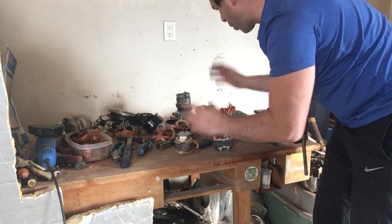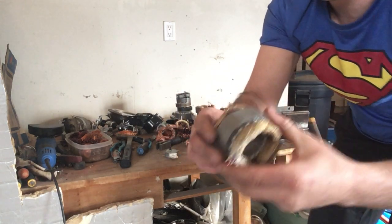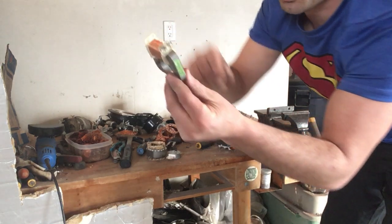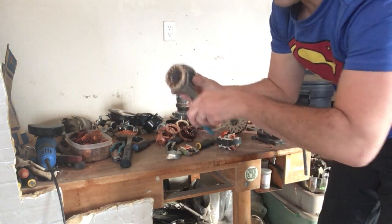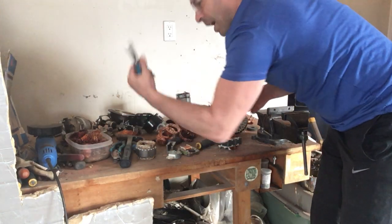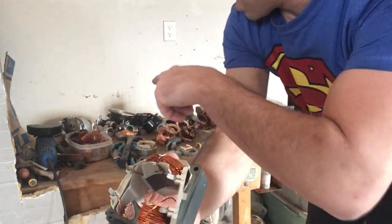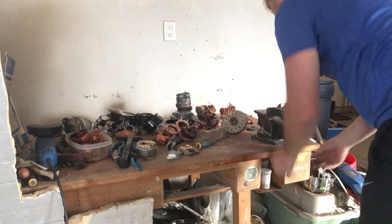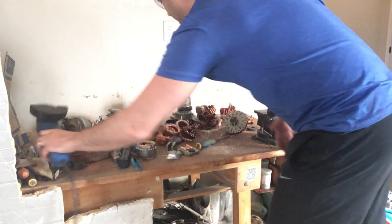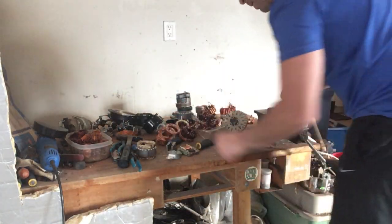The styles of motors you're going to find — some of them will have two windings of copper, some will have a large ring of copper around them, and they're very easy to take apart. This is one of your motors from a microwave. For me, the nicest thing is you can use a pair of tin snips to cut around this, or a pair of heavy duty pliers. I do like using a grinder at times to speed up the process. All I've done is used a grinder and put two incisions, one there and one there, and I'm going to flip this over and let science do its work using leverage. Some people don't like using a grinder because it does leave a little bit of copper dust. When I do that, I will always put something underneath it to catch that copper dust and still put it into my number two pile.